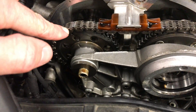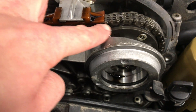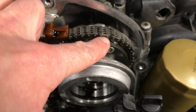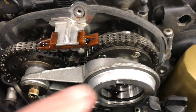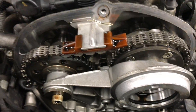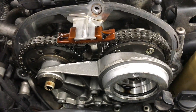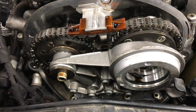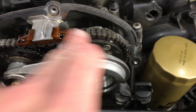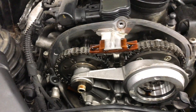There are supposed to be 12 outer links between the timing teeth — one through twelve. If I'm incorrect you can correct me, but there are 12 and a half here. To get the cams into this position, you just crank the engine clockwise until these are pointing up like they are in this video. Anyway, thanks for watching.